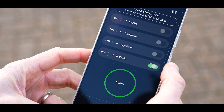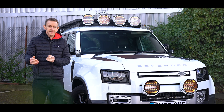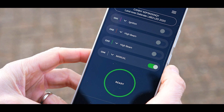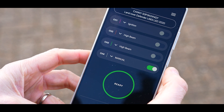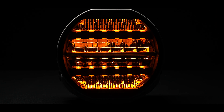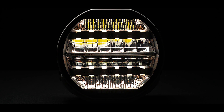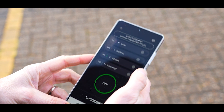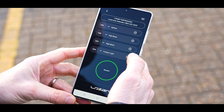It's the same process — position light on for 20 seconds using Canny, and then after 20 seconds rapidly turn the backlight function off and back on. The lamp will give feedback by flashing to confirm it has changed mode. Then on the Canny device, I can change it back from manual and use my phone to select it to come on with the side light circuit.